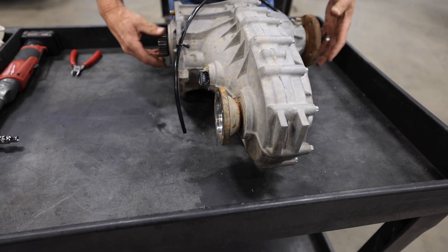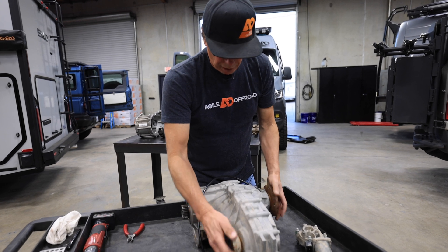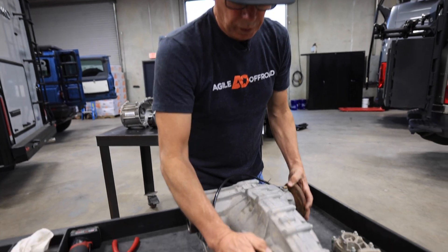When you're driving this, not only will you be driving the rear flange, but you'll also be driving the front flange. Once you've got that engaged and you're in 4WD, you can select the low range and change the gearing inside the transfer case to give you even more torque.